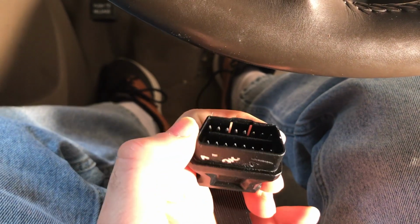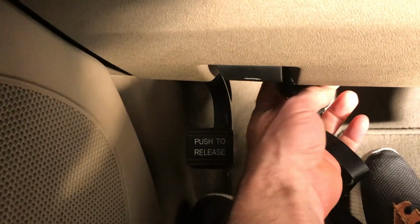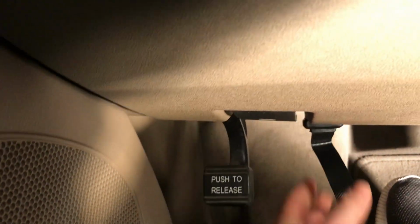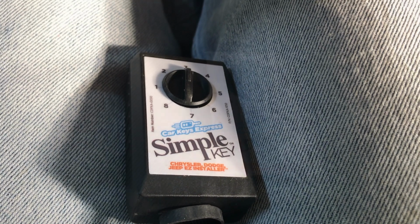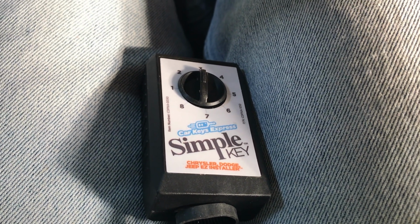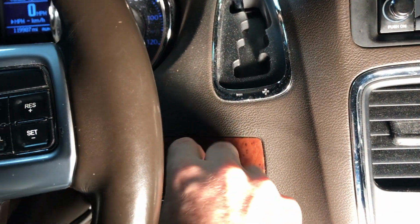Now after you have removed the seal, you're going to plug that into the OBD reader, with the wide end facing you as you go down, and that is right down in this vicinity. You'll feel it right there. Plug that in. You heard it beep. And now we heard the little beeps. If you hear a series of more than 3 rapid beeps, then there's an error occurring. But now that we've heard that, we can turn the ignition off and remove the key.